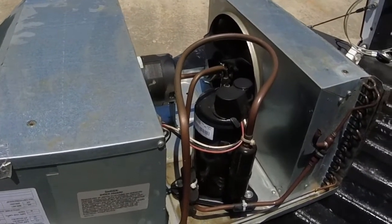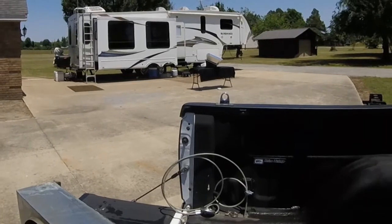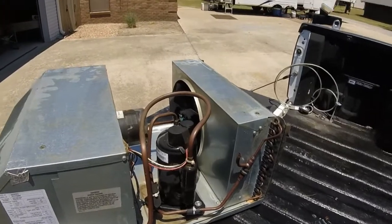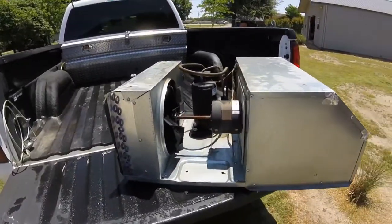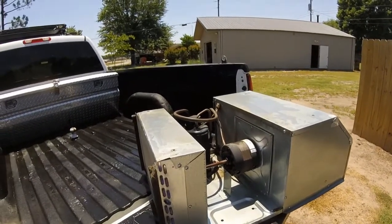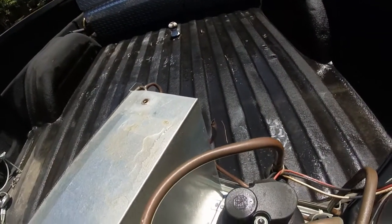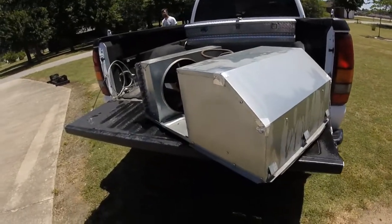This air conditioner is only one year old, but that's okay. It's summertime — I've got a new one up there, a 15,000 BTU Dometic, and it seems really nice. It is cool in that RV right now at almost 80 outside. My buddy has a way to pull a vacuum and charge the old unit, and being summertime I'm sure there's someone who'd like a nice unit. The manufacturer just dropped the ball — they should have put some solder on there. This is a Coleman, so if you ever go to buy a Coleman, tell them to take the cover off so you can see if they soldered it shut, because a penny's worth of solder would have solved this problem.